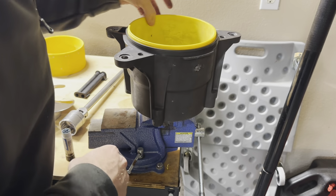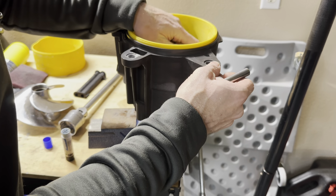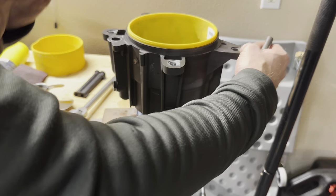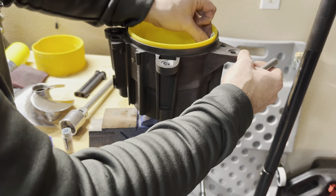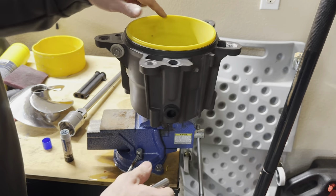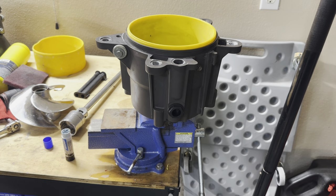And you're going to see it's going to bulge out a little bit on the wear ring here, but don't worry about that. Once we get the impeller in and it makes its first turn, it's going to cut that right off. So now we're going to need to put a little bit of spray silicone in here on our wear ring to help our impeller slide in better.